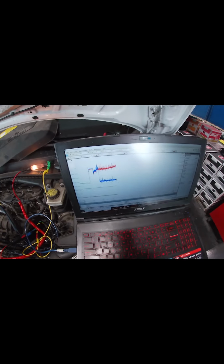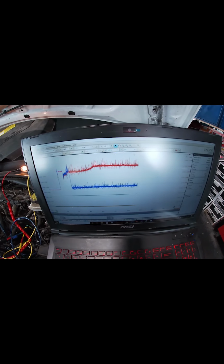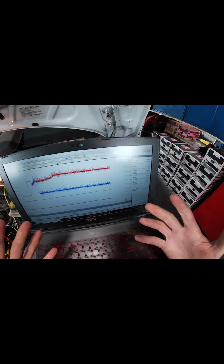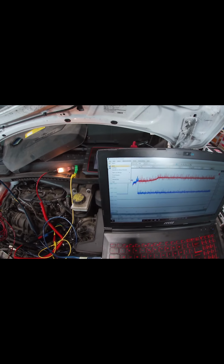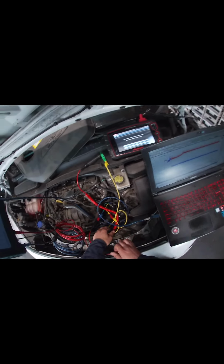But now it'll look like the waveform before, but much different because it spits. And it's gonna stop before I hit stop because it's got a trigger, single page trigger. And now I'll save it. Valve disconnected. New valve. Truck is fixed.